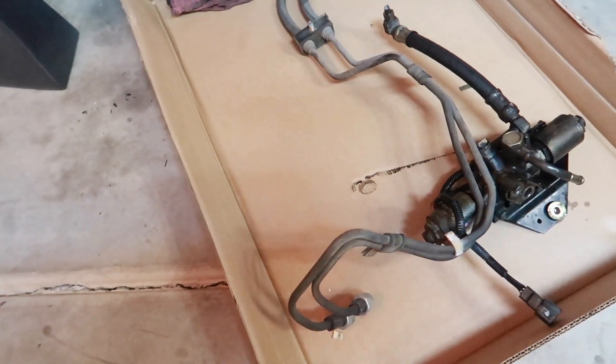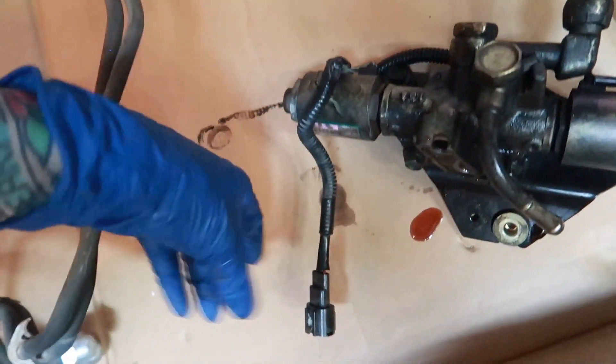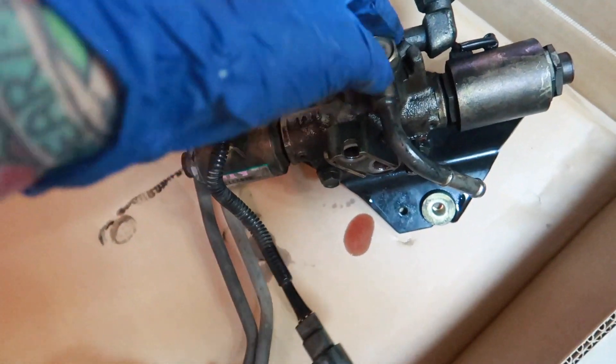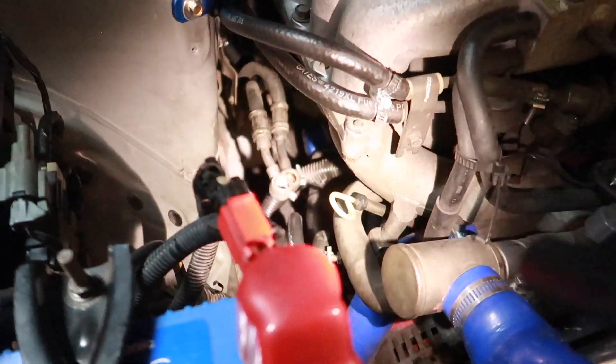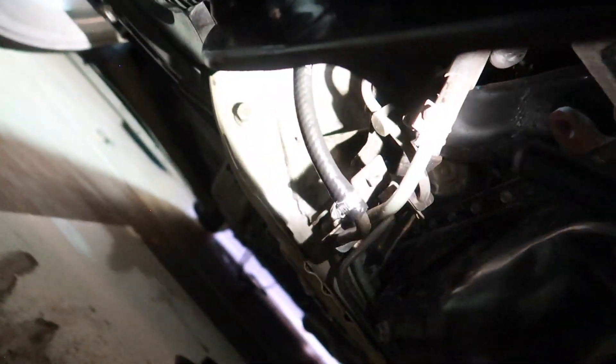So these are the rear lines — you should have gotten those out already. Just got out the HICAS pump; here is where I cut it with the angle grinder — pretty easy. Go ahead and undo this connector and finagle the pump out. There is where the HICAS pump used to be — we've got a lot of room now. Here we have the 5/16 transmission hose connected to the power steering pump, looped down below with a clamp. Make sure those are super tight, and after a couple of drives re-tighten them because it gets hot down here and metal expands.